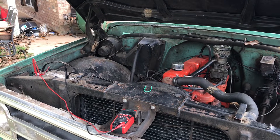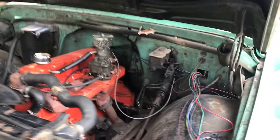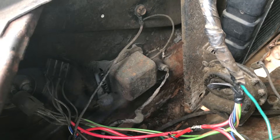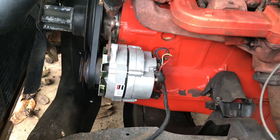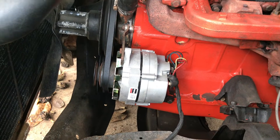What's up YouTube? Today I'm going to show you how to test your voltage regulator to see if it's bad. On an old externally regulated vehicle like mine, the voltage regulator tells the alternator whether or not to turn on and sends it the initial zap to get the charging going, so it's not just spinning and doing nothing.